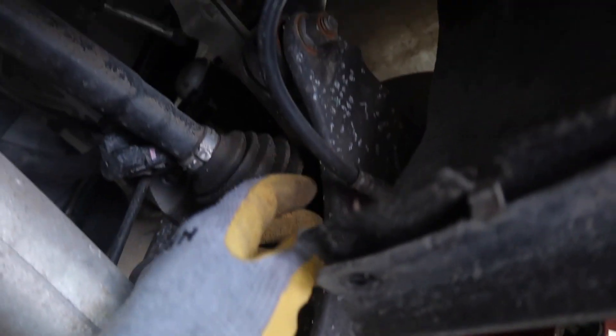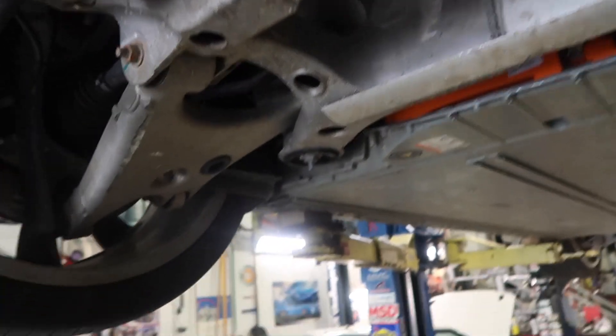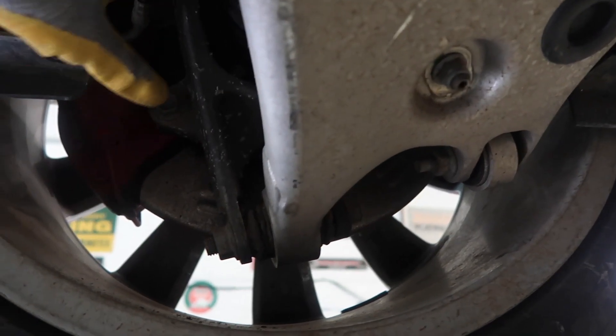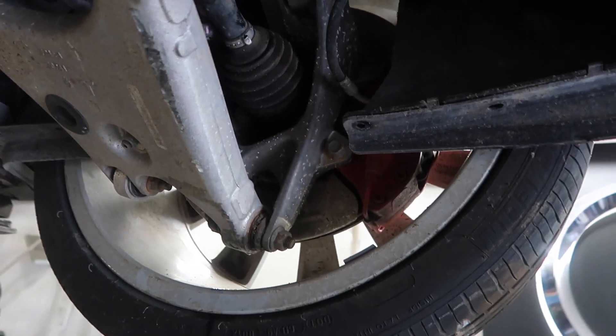Man, this thing is easy. So now what we're going to do is get in here — those are the shocks. We're going to undo that and that will allow the whole thing to come down from the actual body itself. There's one on each side, and then it's the brake calipers. We can just pop the calipers right off and let them hang somewhere. And then after that, four bolts — doop doop doop doop. That's it. We got a date.